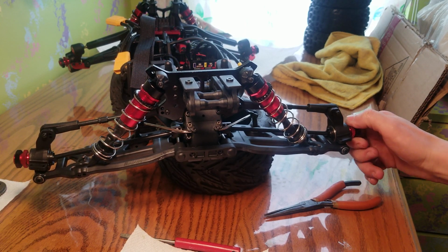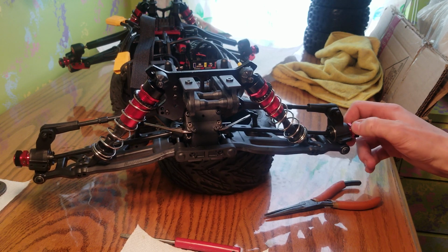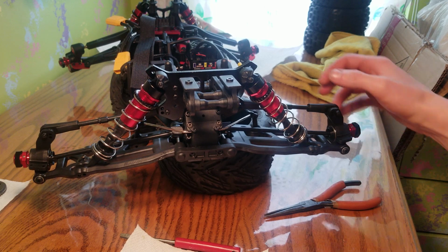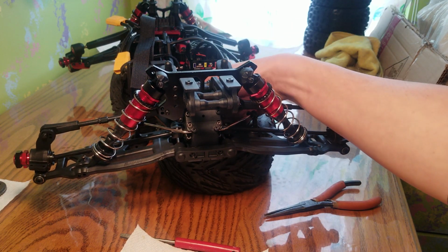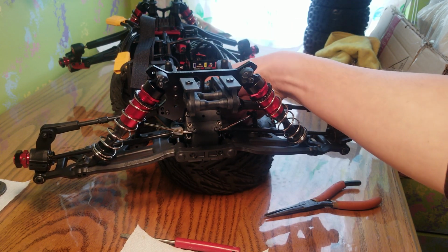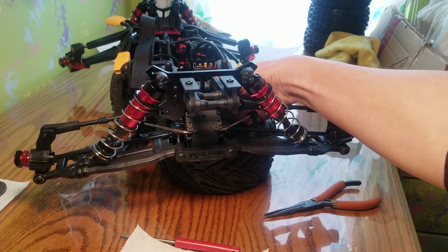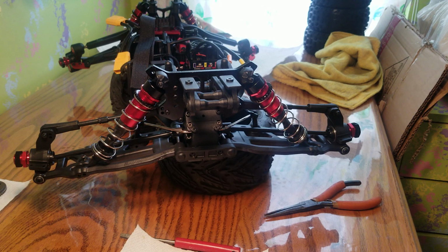That ring and pinion gear is a little noisy. Maybe it'll seat in. That's maybe the grease bubbles. I don't know. Yeah. It feels smooth, though. I mean, it's noisy, but it feels smooth. So maybe it'll kind of seat in. The teeth will kind of quiet down a little bit. But yeah, that's basically all there is to assembling the differential. It's the same thing in the front. Just you're working with the front of the car versus the back.